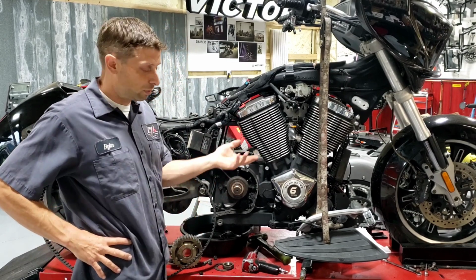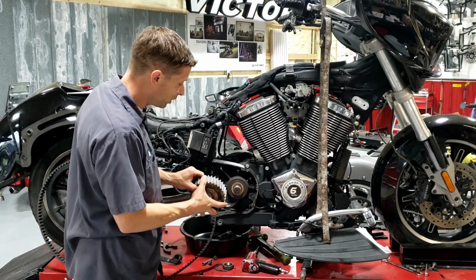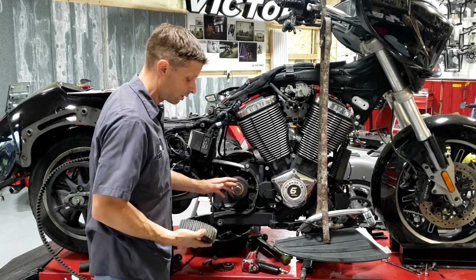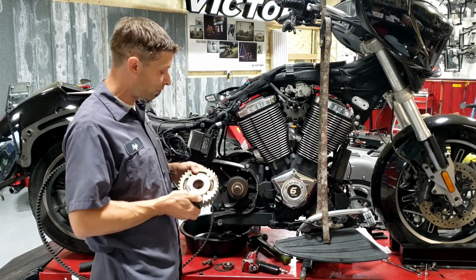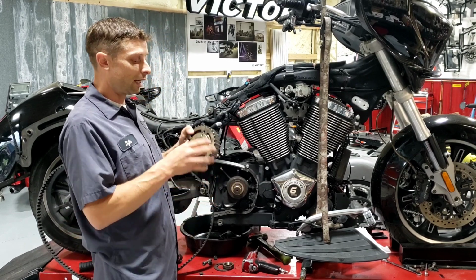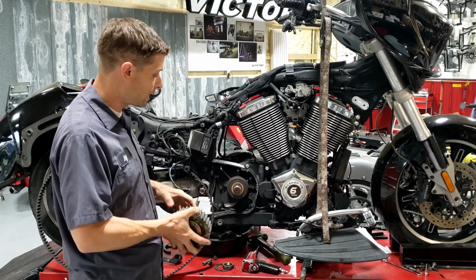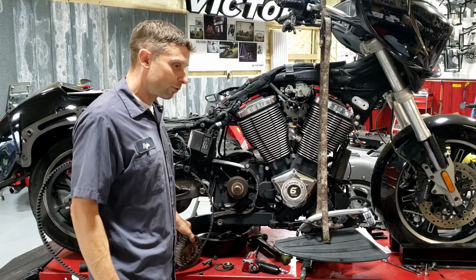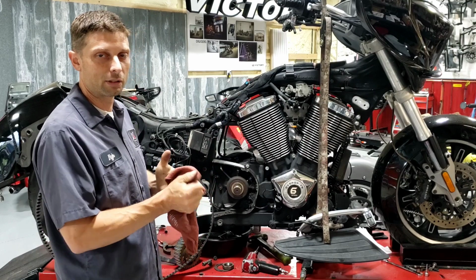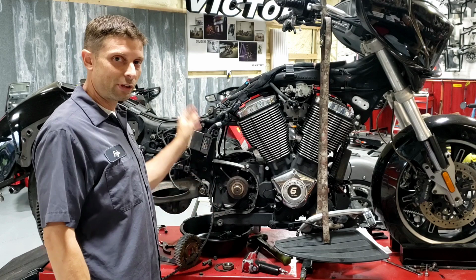But if, back to the third point, you get it apart and it's like this one where this pulley is super sloppy, I mean, it's totally ruined the shaft and the pulley. So in certain instances, this pulley will loosen up and it starts to ruin the pulley, but the shaft is still savable. And so you may have an instance where you got a transmission noise and you're like, what is that clanging noise? And you know, everyone on the internet's telling you it's this, that, and the other thing.